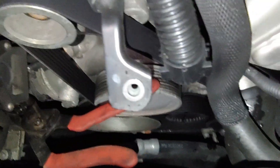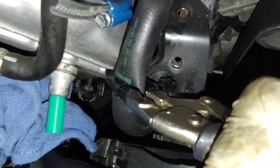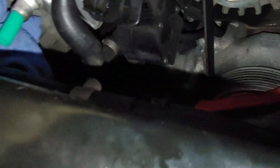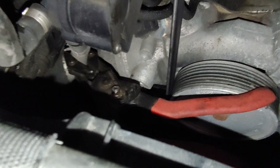I got the clamp slid down. I like to use long needle-nose straight pliers — they work pretty good for that: squeeze it, wiggle your clamp down. I've got these hose clamp pliers blocking that lower pipe off. If you don't have these pliers, take a pair of needle-nose vice grips, wrap some black tape around the jaw so the teeth don't shred your hose, and clamp down to close the hose. You don't need to clamp really tight — just enough so both sides of the walls are touching each other and blocking the flow. You'll still have a little bit of drain between that hose and the clamped-off hose down there.